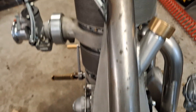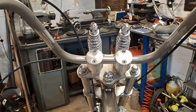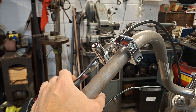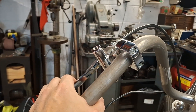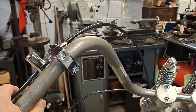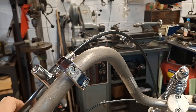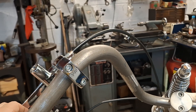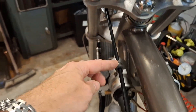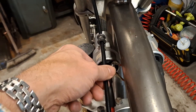I've really enjoyed doing all of the big stuff — the engine, the gearbox and that — but the things that are left aren't quite as interesting, but need to be done. You'll notice on my left hand I have a clutch lever, and I also have a clutch cable. That clutch cable needed to be purchased, cut to length, the outer trimmed and the end soldered onto the cable. I've taken the cable round here underneath the front yoke and clipped it onto the top of the coil, which is a good support for the cable.